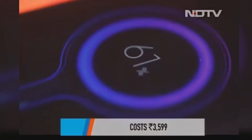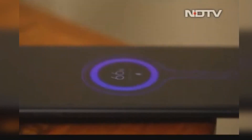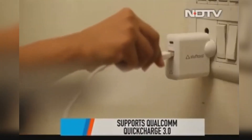This 65W charger could juice up phones in no time. There are two ports: a USB Type-C port rated at 65W and a USB Type-A port at 18W. Charging using just the 65W port, it juiced up an Android phone from 20% to full in under two and a half hours. The USB Type-A port supports Qualcomm Quick Charge 3.0, and when using both ports simultaneously, the maximum output drops from 65W to 45W.